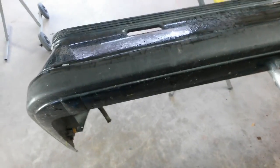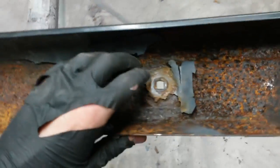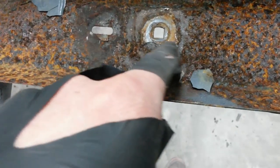There's some kind of port over here on this side — I'm going to have to take that out; he wants to get rid of it, it's got a hose on it. Get these moldings off and it looks like that's one solid piece on this one. I've got both end pieces off finally. The rear bumper brackets are maybe salvageable — they're still rusty, really rusty, but I might be able to reuse them. This section in here — I was tapping on the outside to see how thin it was and went through it. So that right there might have to be cut out and replaced. I can cut that section out, lay a piece inside, and weld it on so that carriage bolt will still sit down underneath the cover.